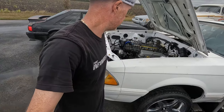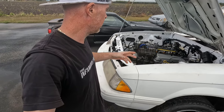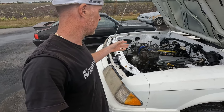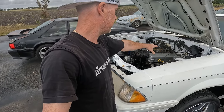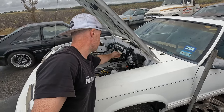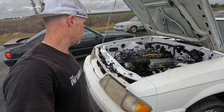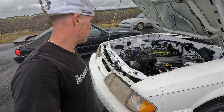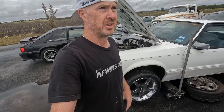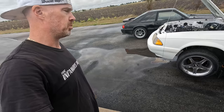All right, you figure, you know what? I might as well start getting some stuff together here in the engine bay. I've already started plugging in some of the clips. I'm going to get the ground straps connected at the back of the block, both the grounding strap off the firewall and then the one for the injector harness. Those are both critical components to have hooked up. And maybe I'll get the radiator jammed in with the pipes. And if the rain actually has stopped for a little bit and some of this can dry up, that would be amazing.